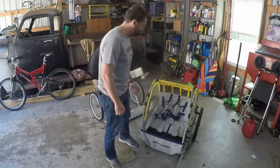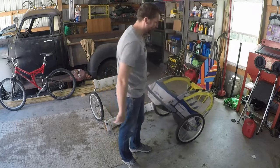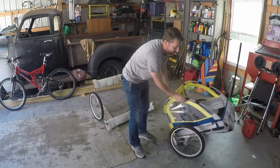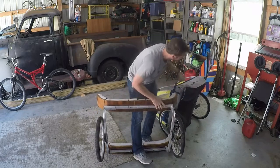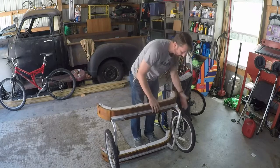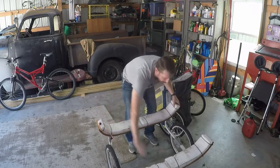This is what I started with, just your regular old bicycle trailer. When I put it up on the canoe, you can see that the canoe hit the wheels, so I was going to have to put something up really high. The frame comes over and dips down, and the hubs for the wheels are right here. So what I did is I rotated this — I unhooked these hubs, flipped them down to get me the most height, and now that brought the wheels wider and also pushed them down so the frame was up higher.